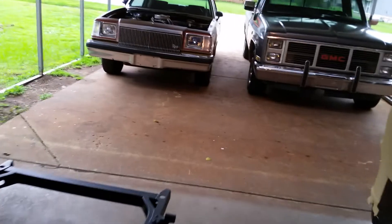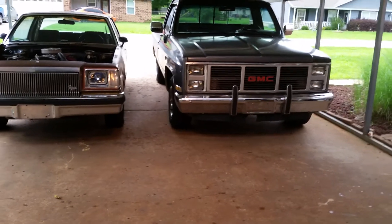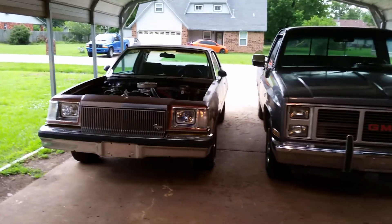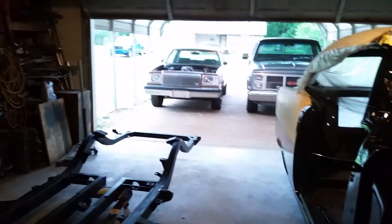I haven't done anything to the chassis — I really haven't done anything to the 55 in a couple of months because I didn't mess with that Regal, since I've got to have a daily driver. And I have got to do an engine in this truck pretty soon. It is knocking on the bottom end — it's kind of light, but you can hear it after it's warmed up, and it's taking a quarter quart of oil a week. Anyway, if I can ever get the dash paint to the right color and work out, I'll be able to put the dash in and start driving it. I've got the hood out in the fence area; I just need to get help and get it put on. That's a pretty quick update and that's it — I guess I'm going to ride out the storm.